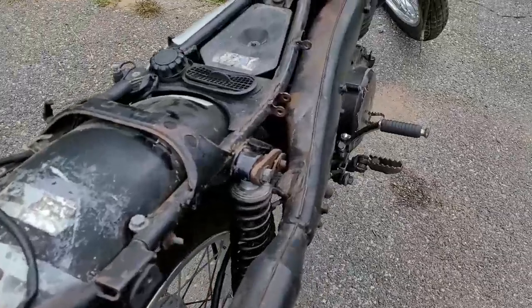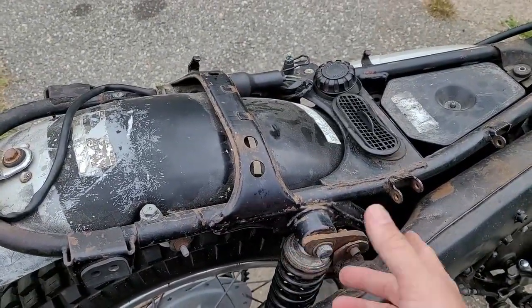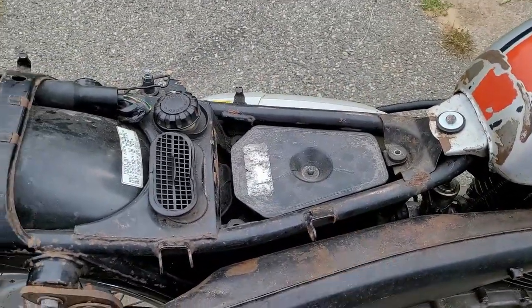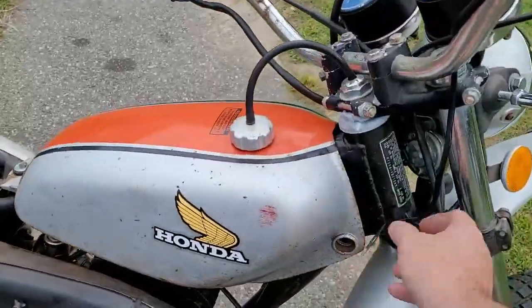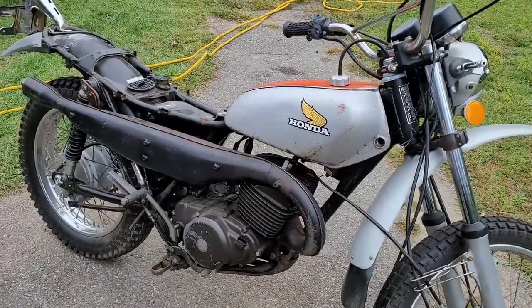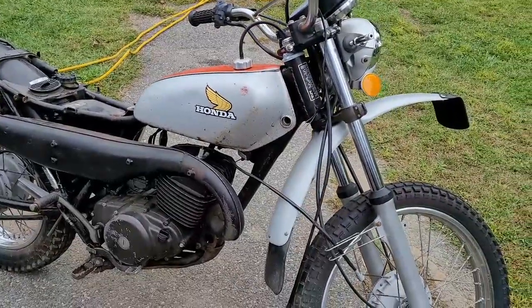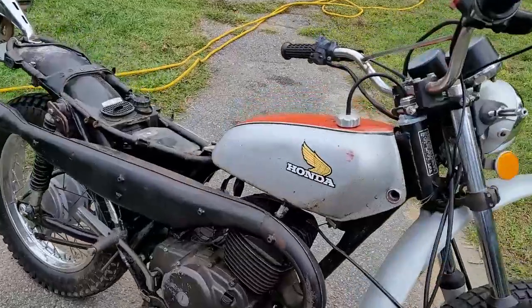On this side, it's got the wrong mount for the exhaust — one ear is broken off the frame, the hardware is missing, and the system wiring is disconnected, including the kill switch wiring. So there is a lot wrong with this bike, but there's also a lot right with it.